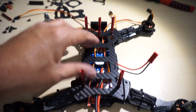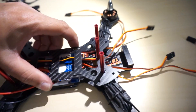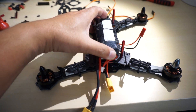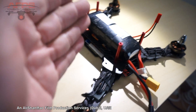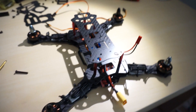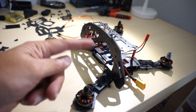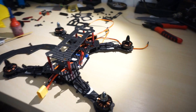Here we are — this plate is installed and I have left the ESC signal cables coming through the forward section for now. Later I will adjust and see if I have to run the cables from here or from another place. This is your battery compartment — your battery will sit here. I'm gonna use a 3S 3000mAh or 2800mAh battery; the swollen one is only for testing. Next we're gonna install this plate on top, which will carry the cc3d and everything, and then the side covers will come up on the sides.